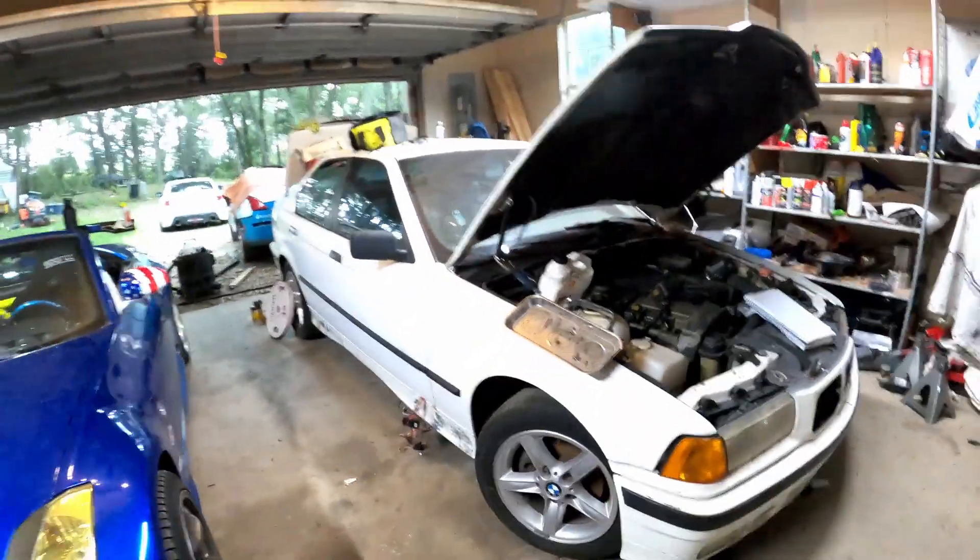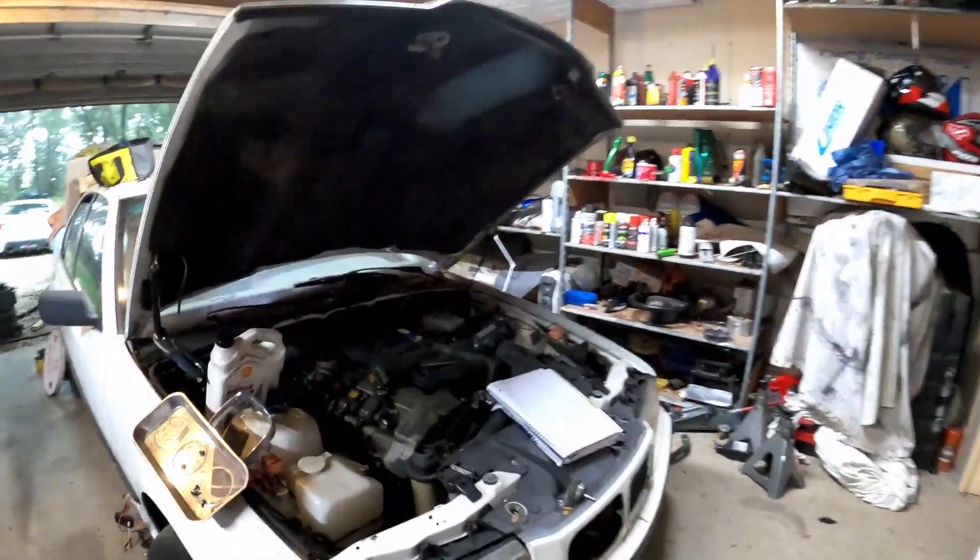He has a vanos 2.5 E36 computer, which is not the one I need — or I think I need. I changed the fuel pump, the fuel pressure, checked a few things, checked compression, and it just seems like it doesn't have spark. A buddy of mine looked at it and thinks it's either the ECU or the connection to the ECU. I checked the pinout and it is getting power. In the forums, people were having similar issues and changed out the ECU and it fixed it.